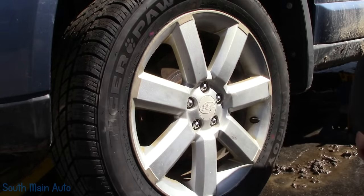That'll do. Got to have a good look at these studs. They don't look like they have any damage other than having a bunch of aluminum in them. We'll take and buzz his brakes off here. Just got to have a gander at things. Stick that there for right now. Pads aren't seized up, that's a miracle. They'll be long gone, we need some new ones anyways.